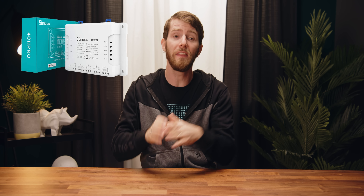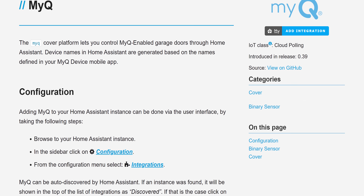Our first Home Assistant solution was based around using my existing Sonoff inching relay opener, a cheap Zigbee hub, and a door sensor. The idea was that after issuing a voice command through Google Assistant, Home Assistant would run a little script to check the door status and then decide whether or not to trigger the garage — preventing me from accidentally opening a door that was already open, which would close it, and vice versa. This is a great configuration because it relies on fewer cloud services. But it turns out the fancy new garage door openers have a direct integration with Home Assistant with support for opening the door, which makes those other limitations seem pretty frustrating and arbitrary.